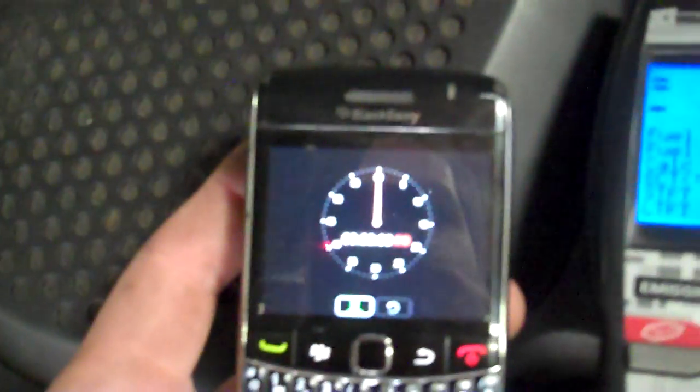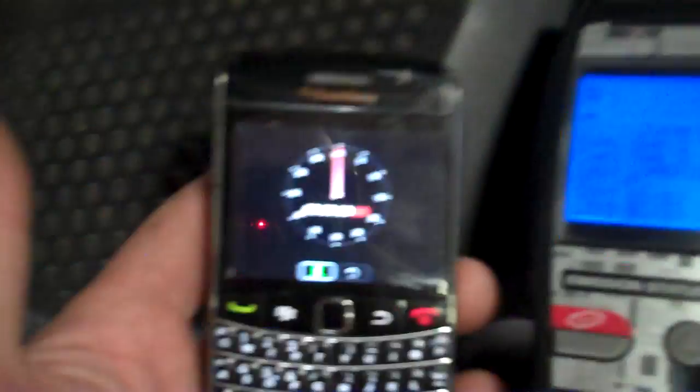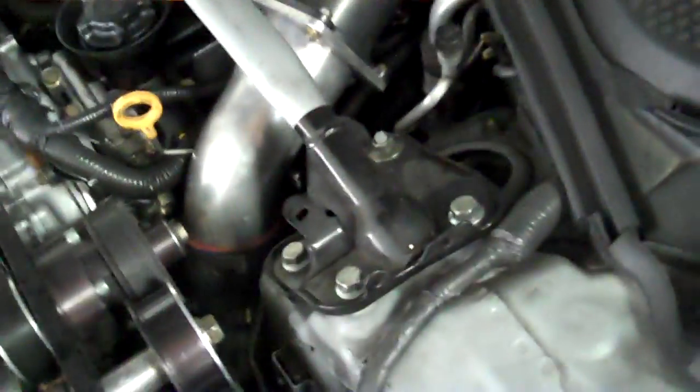What I'm doing is I'm over here with my live data screen and a stopwatch. What I'm watching for is the fact that I have three fans on this car, and I want to show the time difference between having one large fan pulling on the engine compared to having three fans in series. So when this car reaches 210, I'm going to turn my stopwatch on to show how that one big Black Magic fan pulls this car down and how long it takes.